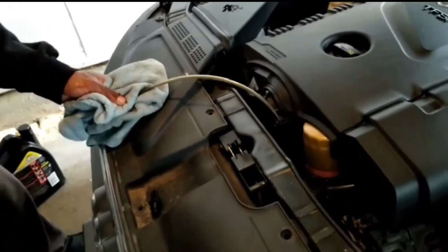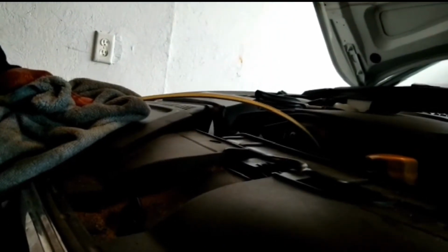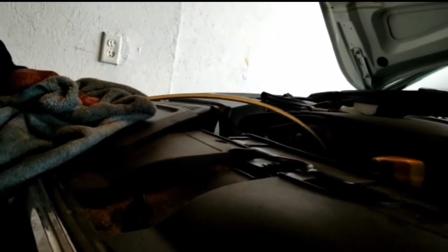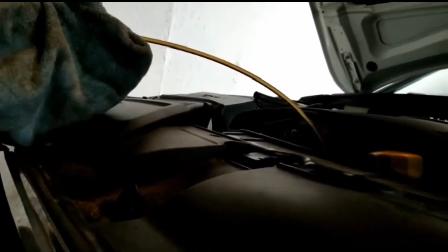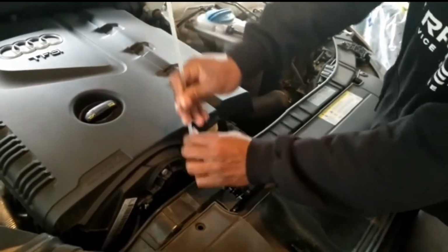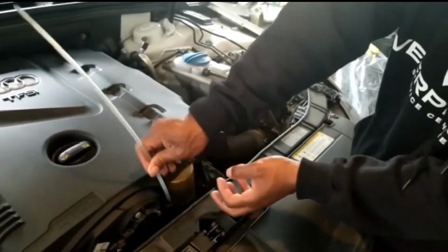We're now going to pull out the tube and just double check where we are with the oil level. Some guides do recommend you use the MMI system, but I personally don't recommend it, considering you have to constantly turn on the engine and let the engine sit, and I don't recommend running your car with the engine on and potentially low oil. So we're gonna do this the old-fashioned way. Clean this clear plastic, put it down inside, wait for about 10 seconds, then when it comes up you should know what level your oil is at, measuring all the way in the bottom of the oil pan.